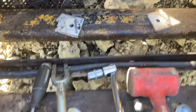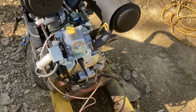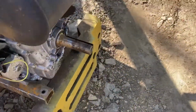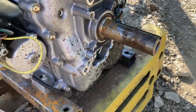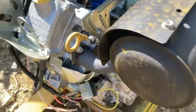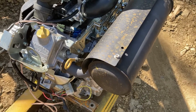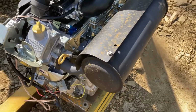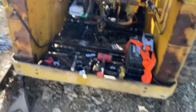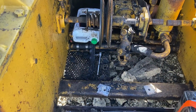So as far as height difference, that's it, like 3/8, not a big deal. Very easy engine to take out of the box and slide back in. Mine is a 1 7/16 shaft with a 3/8 keyway. And the muffler, you're gonna need a muffler that extends, or some type of manifold that extends vertically, because it's too tight for your existing pulley sheave. Mine was rubbing, and also the drive belt completely failed at the same time.